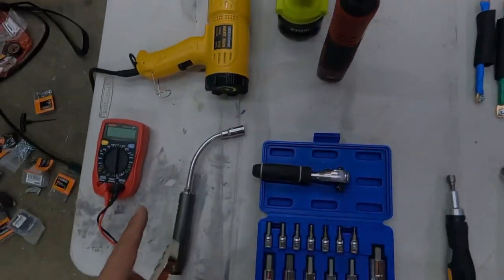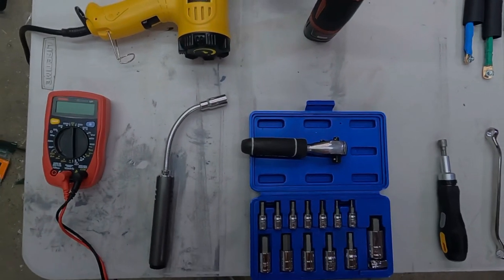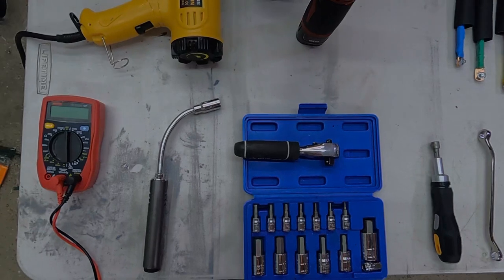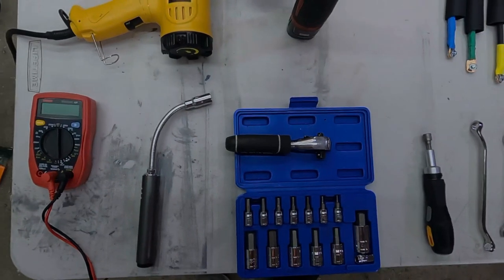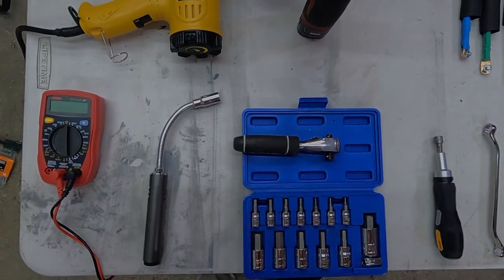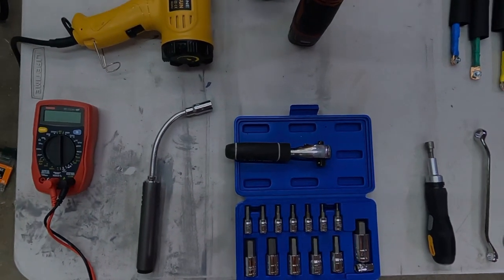But first, we're gonna need to run some tests to make sure that your bike harness wiring can be matched with our harness. Sometimes people add lights to their bikes and brakes and they change the wiring of their bike, but we're gonna be able to work our way through that and show you how to test for that and correct it.